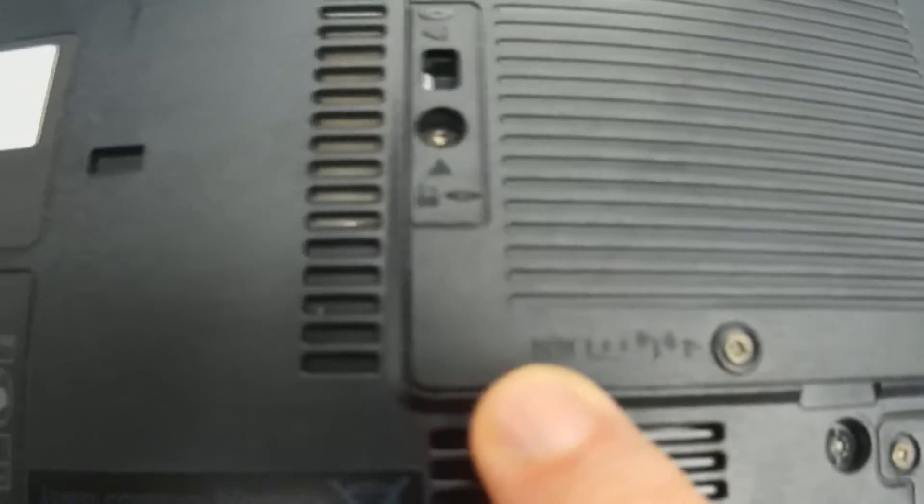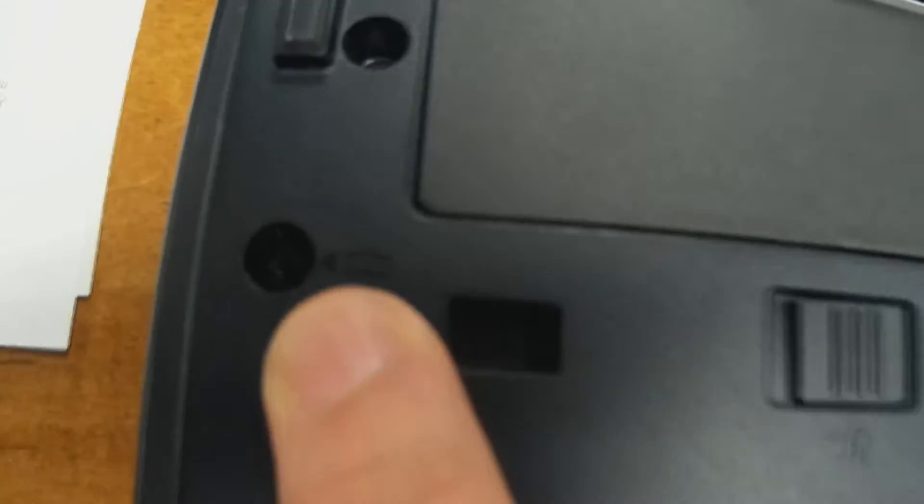With this particular laptop — and every laptop is just ever so slightly different — the one we're looking at tonight is a Compaq 6510B, so that dates it. You can see it's a rather old system, but we can buy time on these old systems by fixing components. You could take this to a shop and they'll say it's really old, but it runs Ubuntu Mate like a dream — it just overheats and gets really slow. Under $10 on Amazon — you can search for the model number, type Compaq 6510B cooling fan, and you'll find it for like $6. Compare that to a $200 repair or having to buy a new laptop. On the bottom of the laptop you can see this little icon that looks like a keyboard, which points to a screw — there are three of them. Quite often we need to remove the keyboard to gain access to the internal components. The keyboard has a lot of stuff underneath it, like the motherboard, the cooling system, the processor — all that stuff is under there.